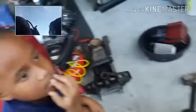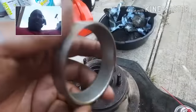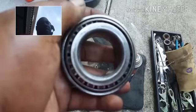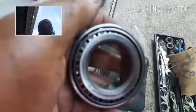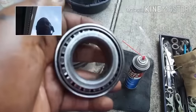I got my little soldier with me — he's out here learning. Just showed him how to knock the cone out. You can see all the fine play I got — you can see all the scratches and indentations in the inside of the cone. This is what your bearing sits inside of, sits in rows. This one got a lot of play, so I'm going to have to change it out. It says it's always best to change them out in pairs, but that's probably what I'll do — I got a new bearing. The other one I cleaned up real good, it's still good. So I'll slap a new one in there. Stay tuned.